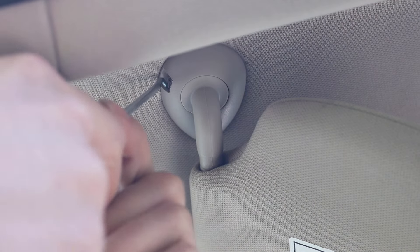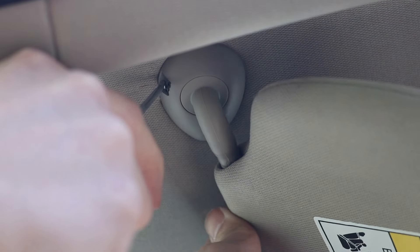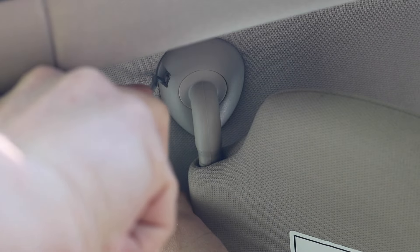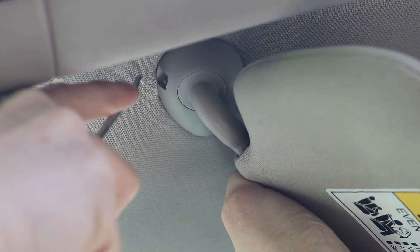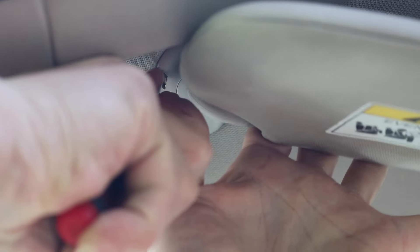You want to take this pick and dig it in here. While you're doing that, you're also going to need to rotate this visor to the right. This will take you a few tries to get it right. So I'm going to sneak my pick in here between the housing and that clip, rotate the visor towards the driver's side door, and just keep working it around. It took a lot of pressure, but I got that to pop in. And now that I have everything rotated, it'll just pop right out.